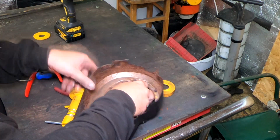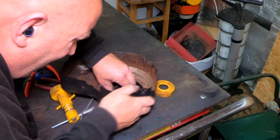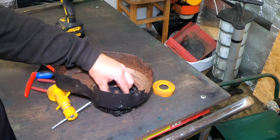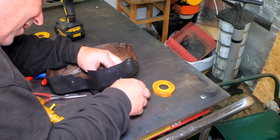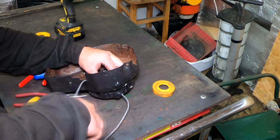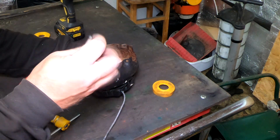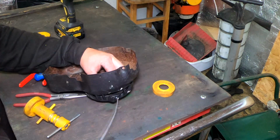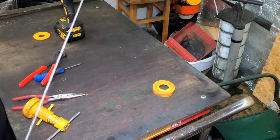Be about there. Hold it. Find your hole on your pull cord assembly, which is going to be there. Get your pull cord, thread it through the hole. Tie a knot. I do a one-handed knot because I've been doing it for quite a few years now. Do a one-handed knot relatively at ease. Pull that back through, pull it tight, let your pull cord go gently.